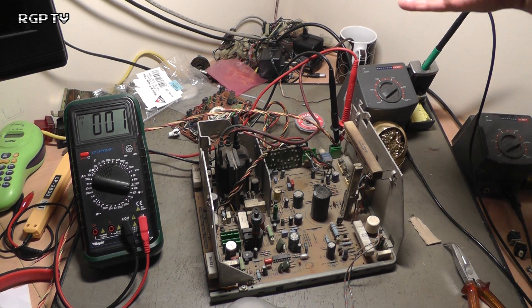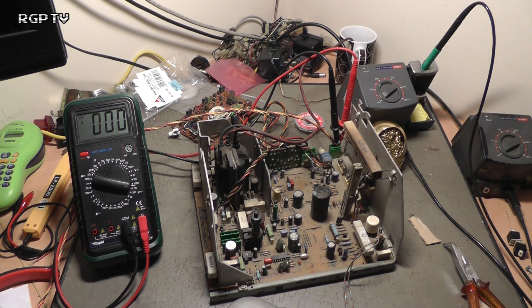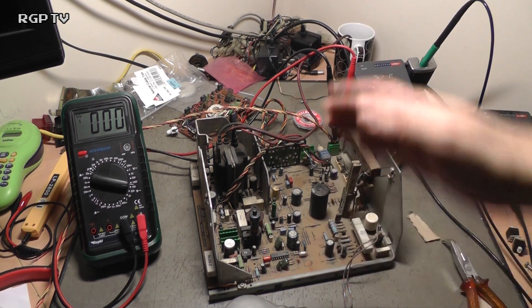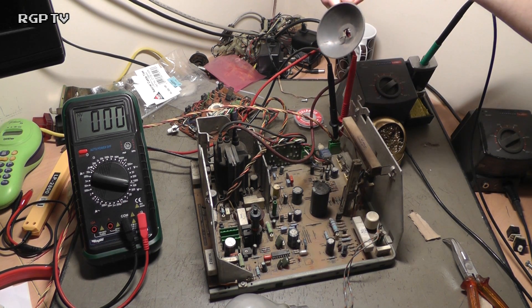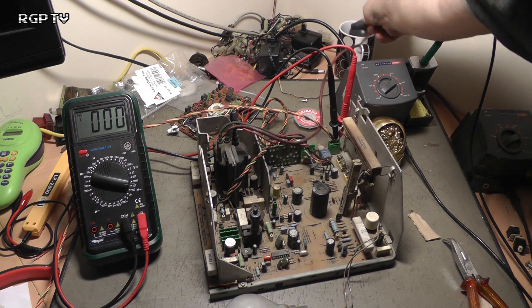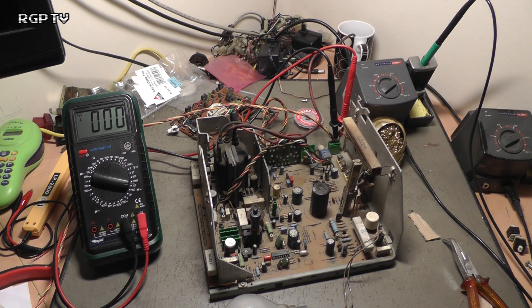It's dangerous stuff — don't play with it if you don't know what you're doing. I don't consider myself a complete expert but I do know enough to insulate myself from any disasters. I've isolated the power supply and I've also placed the anode cap — that's the bit that distributes the 20,000 volt side of it — in something that can't conduct. If I was working on the live side of the chassis with the deflection or EHV side, I would take the precaution of hooking it up to a tube before powering up.